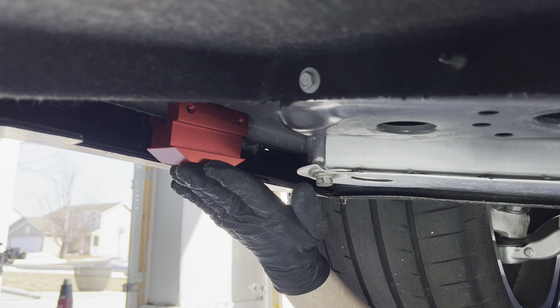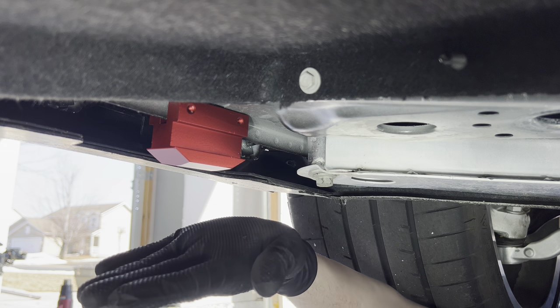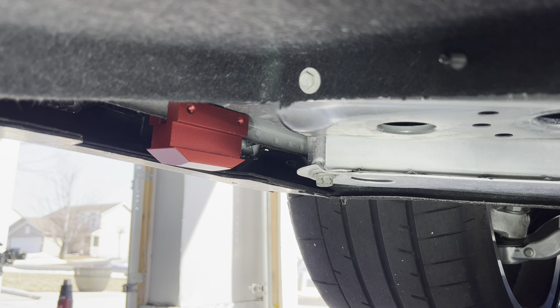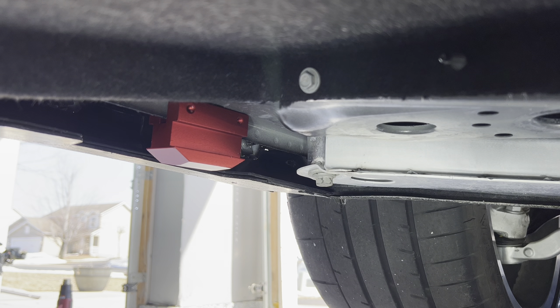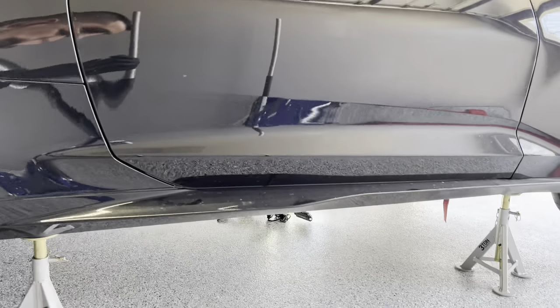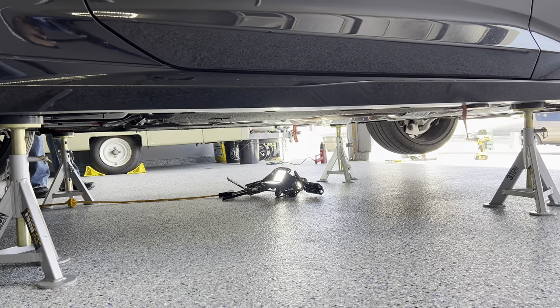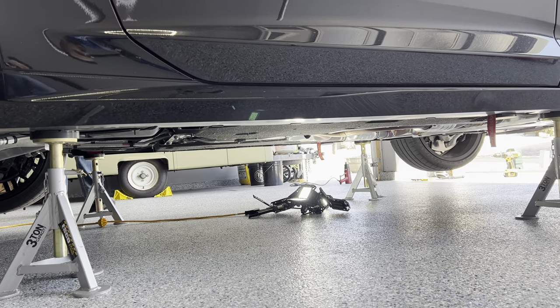There you have it. We've got the front lift point installed and the rear lift point installed — and spoiler alert, it's the same on the other side. You can now use a hydraulic lift on these front and rear, or use jack stands. I suggest you pick up the pinch weld mag puck from ZL1 add-ons — I'll have links to everything in the description. We have the car up on the jack stands on the lift pads that we just installed. If you have any questions, leave them in the comments and I'll be happy to answer them. Hope you enjoyed the video and hope to see you around for the next one.